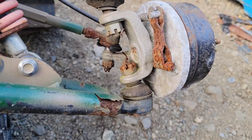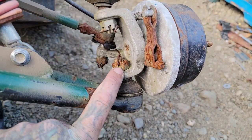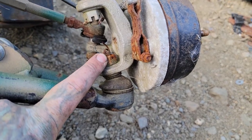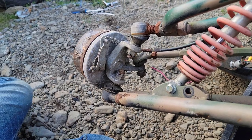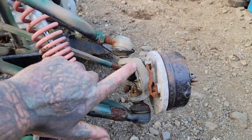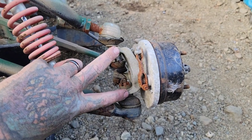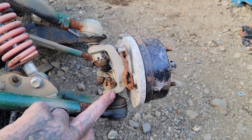On the front end, any steering and suspension on this or most vehicles is gonna have castle nuts. They're called castle nuts because they look like the tops of turrets on castles. Through there they have cotter pins — these little metal pins — and this is what stops it from spinning so it can't back off. Terrence is currently working on removing the cotter pins so we can take the nuts off. We're not going to use the control arms or any of this. What we want is the steering knuckles, the backing plates, and the hubs and drums, because we're going to use the brakes. We are actually going to build a beam axle that these bolt to and make it look like a real hot rod. We've got a plan — it's coming together.